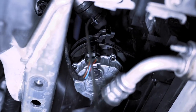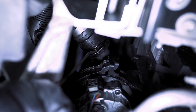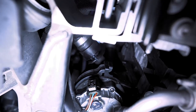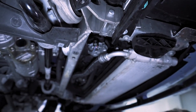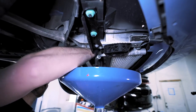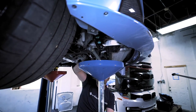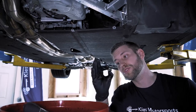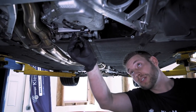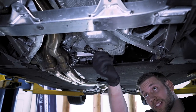Now we're going to drain the coolant. Get under this clip right here and carefully maneuver it down — just like that, and it'll snap in place. Then reach your hand up and gently guide that off. Since this is down to a very slow drip we're going to replace the crush washer. In between drips I'm going to thread this back in — we're going to take care of torquing it down to 20 Newton meters using my Eastwood digital torque wrench.